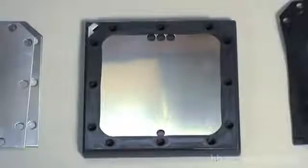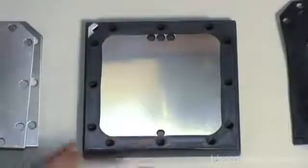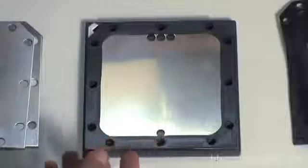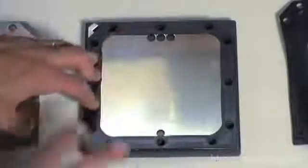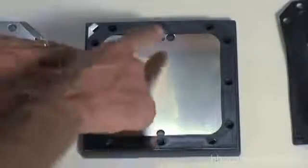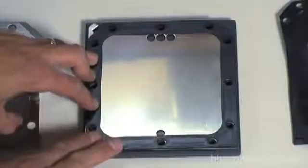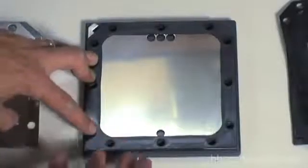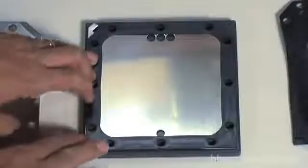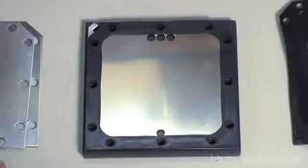That's one of the problems with wet cells. Even where the plates were covered with the inner tube, the bottoms were still exposed and current can jump out of the bottoms of the plates. It's a very inefficient design. In this case, the only place that the current can jump is through these four holes in the plates. The ultimate dry cell is one that has no holes, if you can figure out a way for the water to flow without going through the holes in the plates.